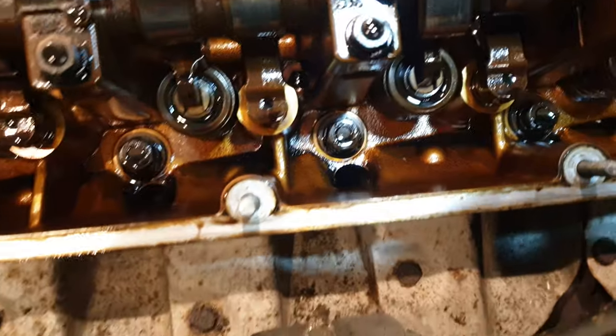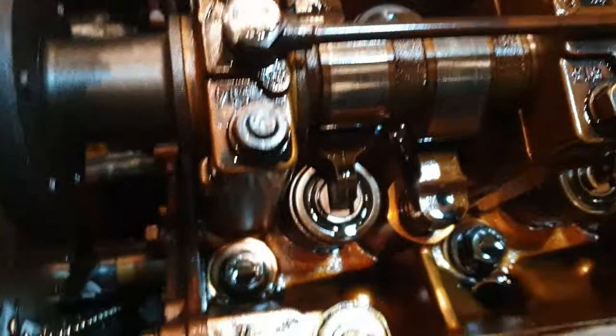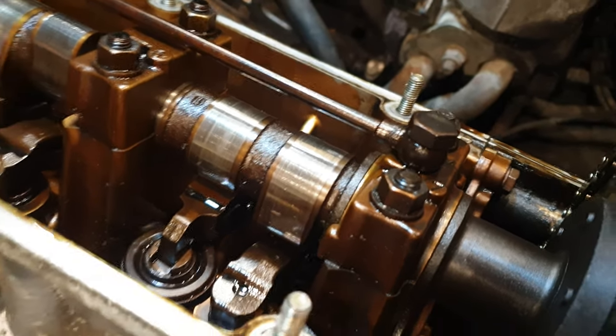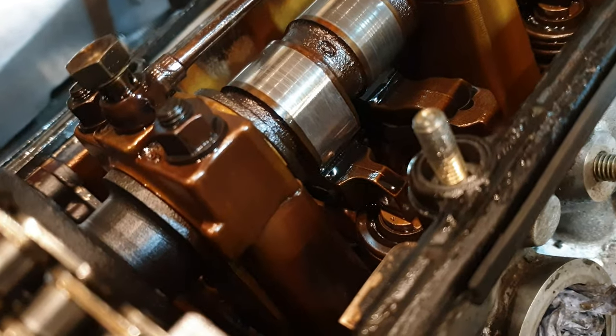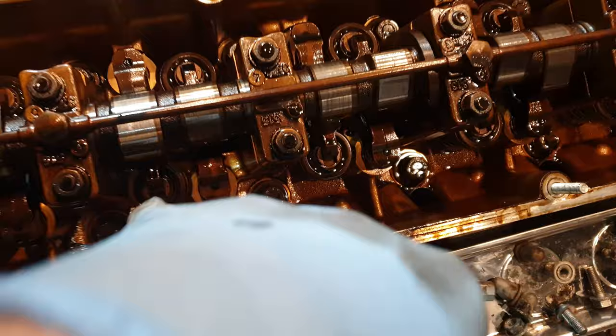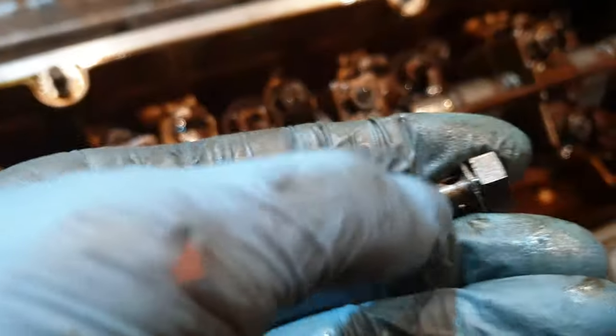I'm not actually sure if it's the same on the opposite side — probably a similar amount. There are a few pools of oil kind of blocking things up, it's probably a little bit cleaner on this side. I was examining this bolt a little bit closer — as you can see there's actually a small washer on it, and washers are installed on all of them. I've actually seen some reports online of guys saying that the washers were only present on some of their bolts, which is very strange, and some guys have actually found the bolts backed out and just lying in the bottom of the pan — which is absolutely crazy, that's cataclysmic stuff. So that is the actual banjo bolt — there's a hole in the middle and the bolt itself is hollow so the oil flows straight through.